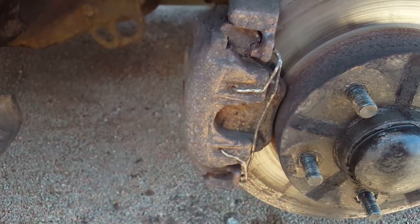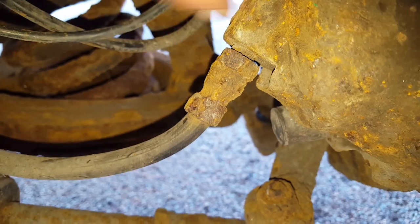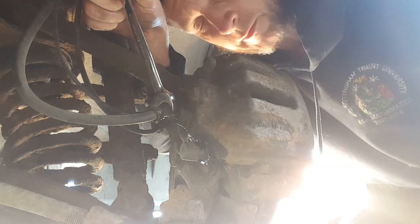Next we need to remove this retaining pin. So before we take the caliper off the car, what I'm going to do first of all is I'm going to crack the brake ferrule here — just loosen it off, because I think it's going to be easier to take it off whilst this is all still nice and solid and not flapping about. Of course I've got to put this onto the new caliper when we get it fitted. A bit of penetrating fluid first. So it's a 14mm spanner that's needed here. Now I don't want to take this off completely because of brake fluid all over the place, but I just want to loosen it ever so slightly. Good, that's turned okay — just want to crack it, that's all. That'll do for now.